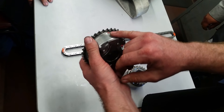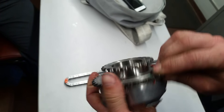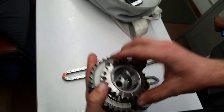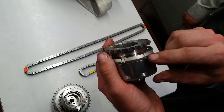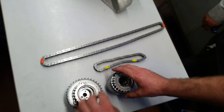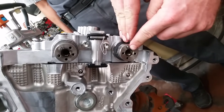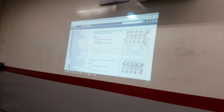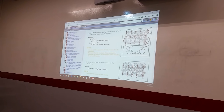There's a small dot mark here — that's the toughest one to see on the inside. The green line needs to be lined up with this line. On the exhaust side, there are a lot of different marks; you're going to go with a single line. Just set them there. We're going to make sure the cams are lined up right — this one's at 45 degrees from top, this one's three degrees from the top. We get that information from Toyota TIS: 45 degrees and three degrees. And this is on the left bank.